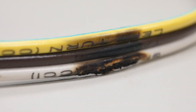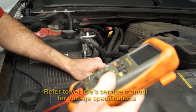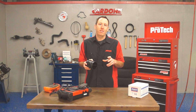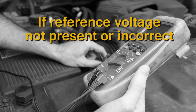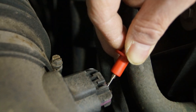Next, inspect the wiring and connectors and repair as necessary. Then, verify the reference voltage and grounds. Typically the ECM supplies a regulated reference voltage to the sensor. If the reference voltage isn't present or incorrect, check the ECM for proper operation. In addition to performing ground continuity checks, you should also perform voltage drop tests on all grounds.